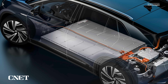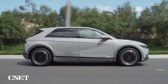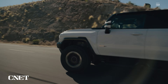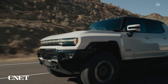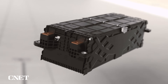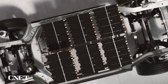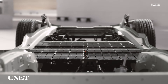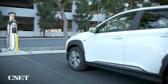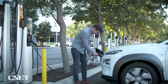The battery is the heart of the thing. This is what mostly determines an EV's range, makes an EV typically cost more than a combustion car, and makes them weigh quite a bit more. It's the magic and sometimes a curse. The battery is typically laid out as a big flat thing under the belly of the car, inside of which there are many smaller cells. Some EVs will diverge from this mattress-style battery and use a few smaller batteries tucked away in different parts of the car. In any event, batteries hold DC power, and that's what gets put into them by the charger.